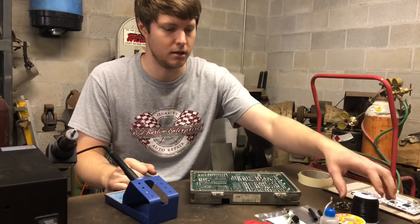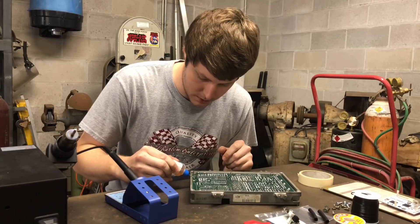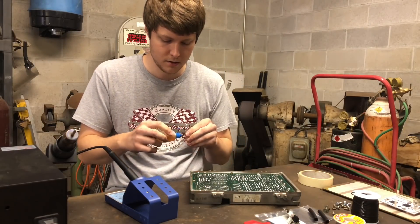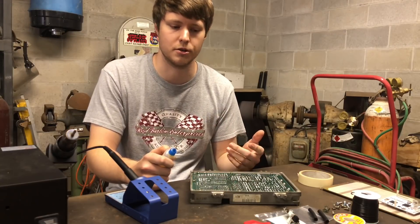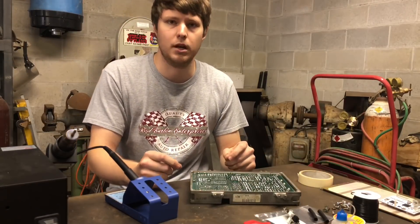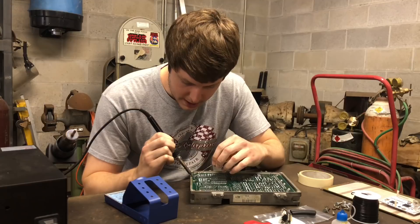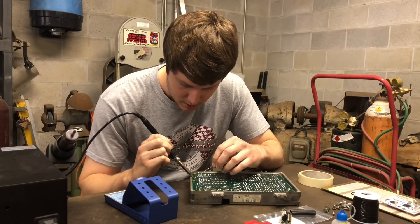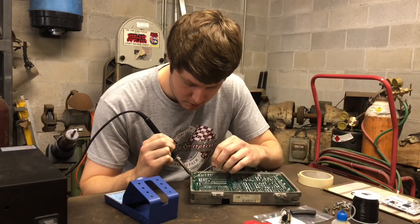I got an email from a guy last week and he said his car started up on half a crank — better than it ever has — and it runs smoother in boost, especially when VTEC comes on. What the whole coil-on-plug conversion does is: a distributor draws about 10 amps, while each coil pack draws about 5 amps, so you're doubling your power distribution to the spark plugs, giving a stronger spark. Stronger spark blows out less frequently at high RPMs, and you can gap the plug a little bigger for more power. Plus, if you've got a dead OEM distributor with a bad ICM or bad coil, you can still use that distributor housing — all this kit needs is the CYP sensor in the bottom of the distributor, which barely ever goes bad.